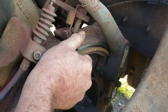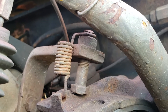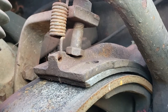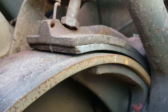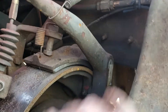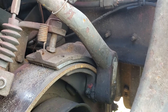The first thing you do is adjust the outer shoe to where it's not touching the drum, and neither is the inner shoe. Once you get this where you want it — I don't have a lot more room to go down because the end of that bolt has been cut off, so I might need to get a longer bolt — you want to adjust this to get your spacing where it just barely doesn't rub when you turn the drum. Then you adjust the inner shoe spacing by adjusting this here, which when you turn it is cantilevered, so if you pull this arm back the inner shoe will go in before the outer shoe goes down. That's how it works.